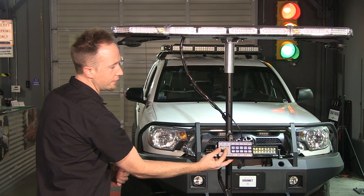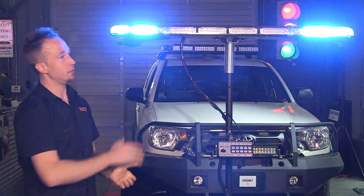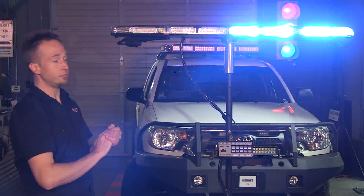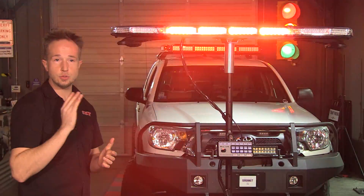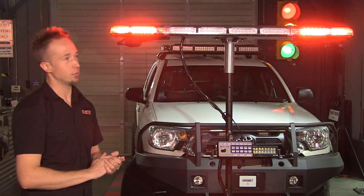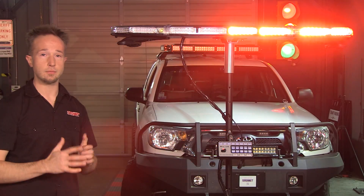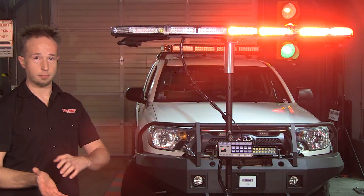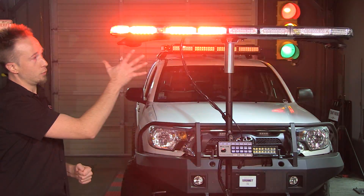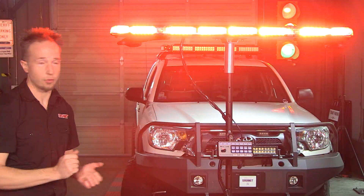The bar and the progressive slide switch have this broken up into independent color displays — all blue with a nice flash pattern rhythm done with syncing, then half blue and half amber to the rear. Now setting over to an isolated red and amber display with the same flash pattern and rhythm mode as the blue. This is a neat way for vehicles where you may have two functions in one — emergency services followed by public works or emergency management. Flip it over: primary color is red and blue, the other mode can be amber and that color only.